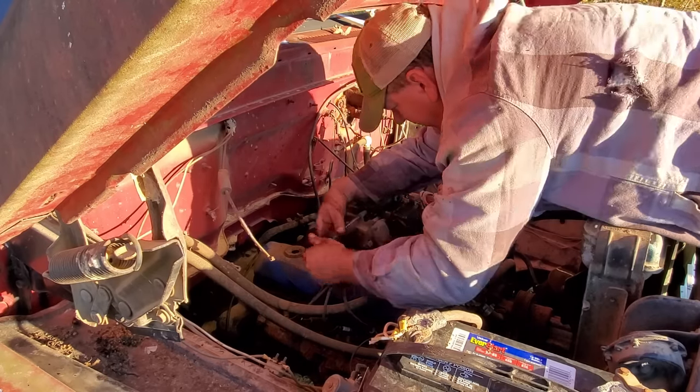Two or three weeks ago, when I came and looked at this truck, I just glanced at the wheel, saw that the tire was flat, and it looked like a split rim. And I was like, eh, I ain't fooling with that, and probably won't find anybody else that will. I'm not talking about the lock ring type. I'm talking about the actual split rim that is outlawed. I've changed the lock ring type, I don't know how many of them in my day, back when I used to work at the tire shop. Anyway, it ain't. It's just a 22.5. They got a tapered bead right here. 22.5, 19.5, 24.5, 16.5, they all got that tapered bead. Be aggravating to get aired up sometimes.